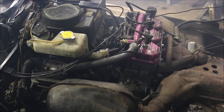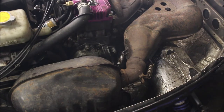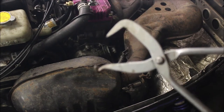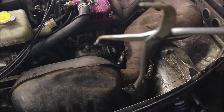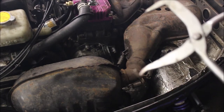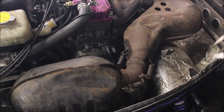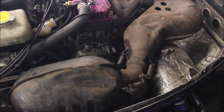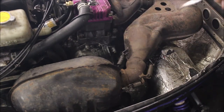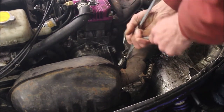I'm going to take this apart and show you how it's done. First of all, to get the exhaust off — I don't know if you guys have ever seen one of these — this is actually for your rear drum brakes, it's to take the spring off. You clamp it on the pad and clip the brakes off. I like to use that to get the springs off the exhaust. Just grab it and pull. Works out pretty slick — you don't rack your knuckles all up.